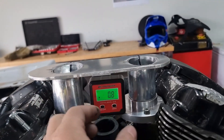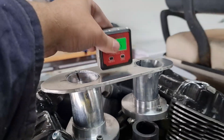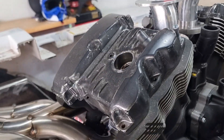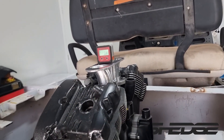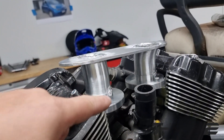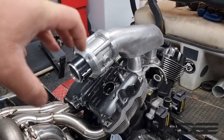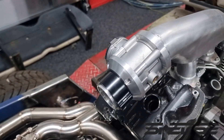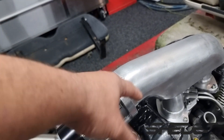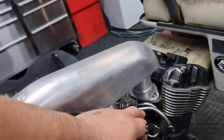We're going to get our planes relatively level before we weld - about 0.8 and 0.5, not too bad. This way it's about one degree out, so after a bit of fine tuning we should be good to go. Time to tack it up. We're tacking those ones in there, then we'll pull it off and weld it all up. There we have it - here goes our completed intake. The drive-by-wire setup is done with all the o-rings ready for the charge pipe. We've run out of argon gas so the charge pipe welding is the last thing to do on the throttle body - don't want to get halfway through and run out.